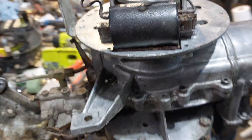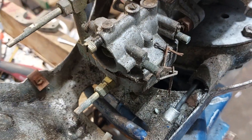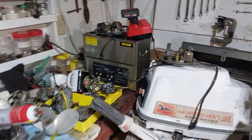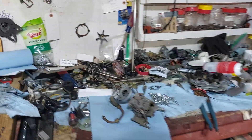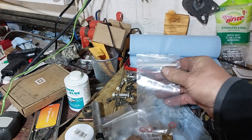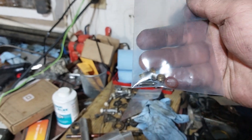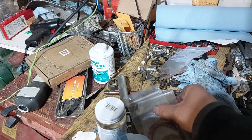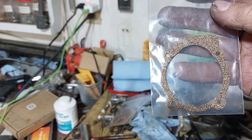I think I should have this one running — I just have to put the ignition system back together. I'll take the carburetor off, take it apart, and toss it in the ultrasonic cleaner for about 45 minutes. I've got Tillotson carb gasket kits from the Martin outboard guy. He's only going to have the parts and gaskets for the MD series, but that covers a lot of the popular brands I work on anyway.